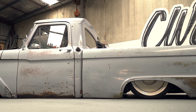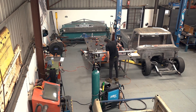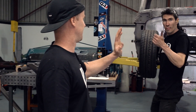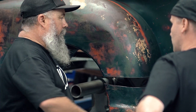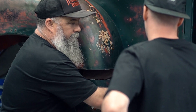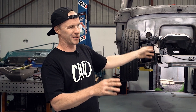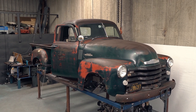I love patina trucks — or patina on any car. They're their original paint; they've seen days that I haven't. This is Adam's corner — he's got sheet metal, folders, guillotines, and whatever needs to happen. We're working on that 3100 — doing modifications with the rear guards to get the 20s underneath, still get it to lay out, and not change the aesthetics and how the lines flow. We're adding 50mm in the front of the tub, which lifts the tub up and also proportions the car. The 3100s' tubs are quite low when you look from the side, so we're solving two problems — two birds, one stone.